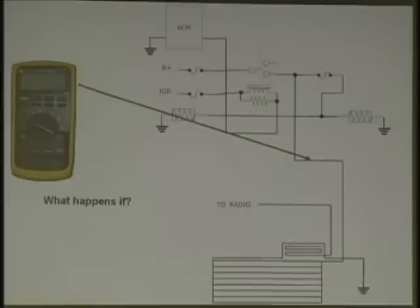Defroster. Now, we take a reading. We got this reading on that wire. Give me that reading quick. 10 millivolts. Good or bad? Good. What wire is that? That's the power feed. So we could take our power probe and see if that rear window would work by powering that wire up, correct? But what's working? These two are working great, same circuit. And what do you have here? A splice. Correct. So where would you suspect that problem?